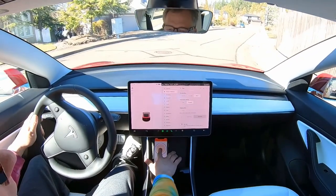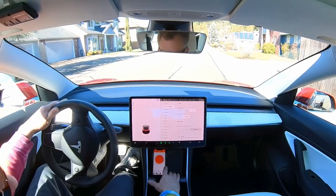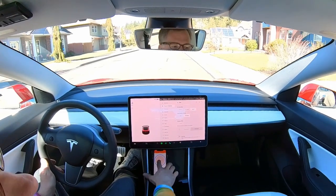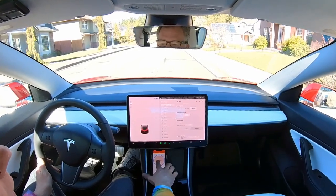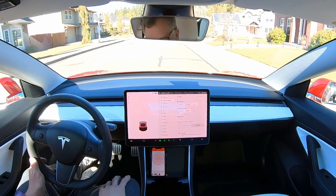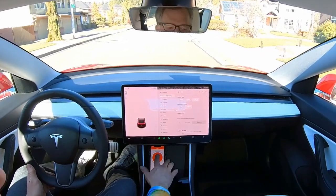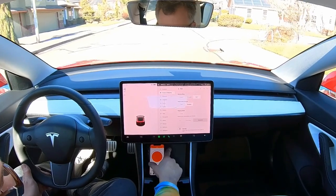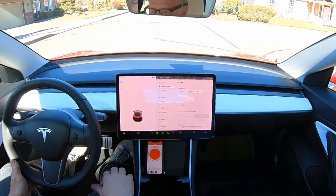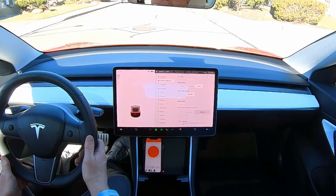If I hit this, it's slowing us down a bit — I can feel that. It didn't lock them up, so let's try 25. Yeah, it's slowing me down to a stop, and I'm basically stopping the car just with the trailer. Let's see if we can go to 30 — that might lock them up. That's a little much, but it slows us down. I think we're dragging the tires there a little bit. It looks like about 25 is optimum.